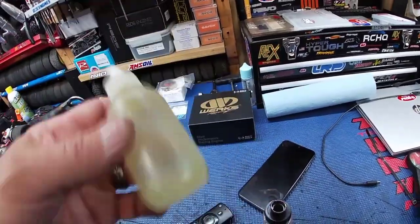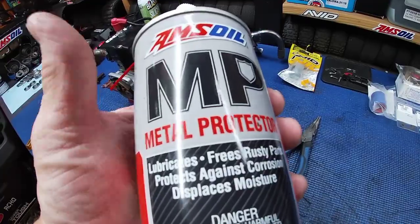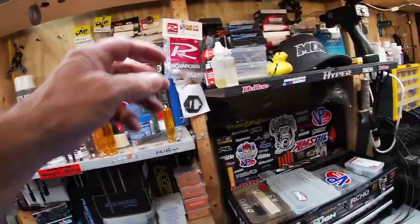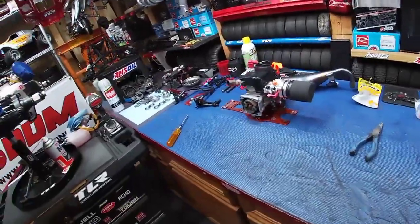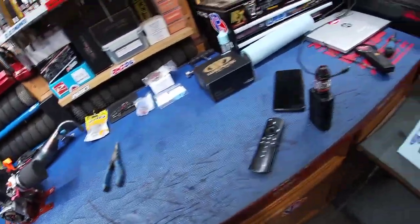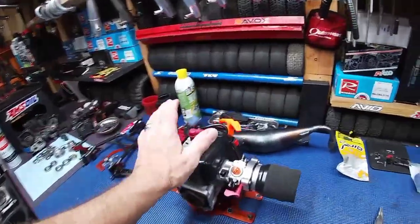I make sure to put a little bit of oil for after-run. I use AMSOIL synthetic air tool oil and a little bit of AMSOIL MP — about three-quarters of the little bottle AMSOIL MP and a quarter of that bottle of the air tool oil. I use AMSOIL products for all my after-run and engine maintenance. We also use the Dominator fuel at 28 to 1, and I've run that ratio from break-in all the way through on this Rovin 36cc.